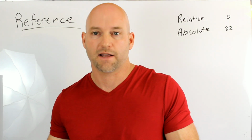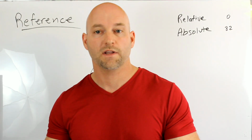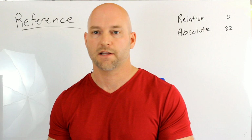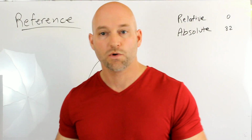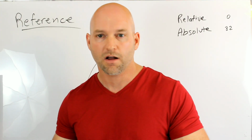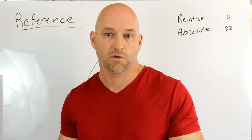Now, it doesn't hurt to go back and check, but more importantly, what we're checking for is that we really want it to be level matched. We want all the speakers to be outputting equally, and that's the important thing that we need to verify. So let's say we're doing it manually, or we want to verify that our receiver is set up for reference, because not all of them are going to be set up for reference. They should be, but just if you want to verify.